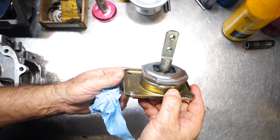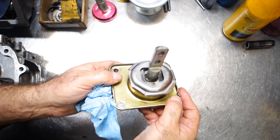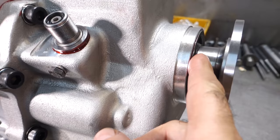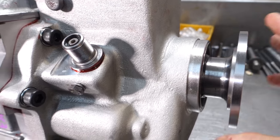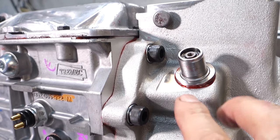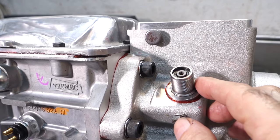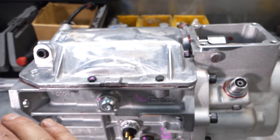This is the shifter base that is converted for the new JT5 shifter — I actually have a separate video on how I put these shifters together. When this transmission is in operation, this yoke actually stays out about this far because there are bolts that go over here and we don't want the bolts to foul against the rear seal — it stays about an inch and an eighth away. Here you can see the speedometer fitting: it's got the same thread as the Jaguar and the same gears inside. The factory Jaguar has an oddball angle drive, so the ratio of the gears is the same and the threading for the angle drive is the same — this whole unit just bolts up to the factory angle drive cable and it's done. We use an offset lever from a GM version and the GM shifter box, bringing the whole thing forward like the S10, but with the short tail.